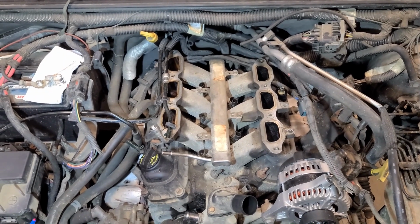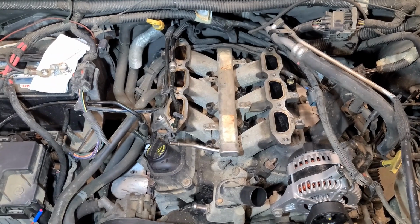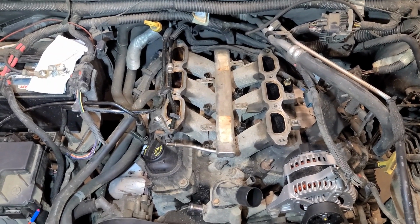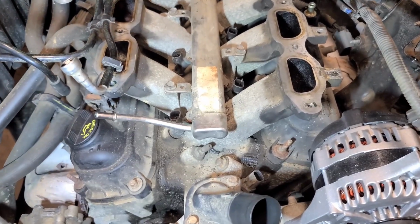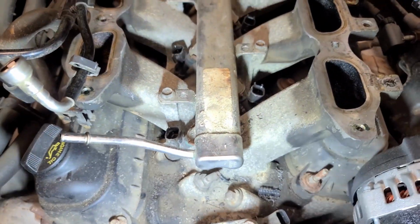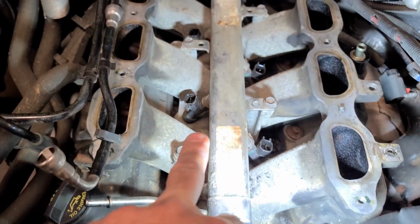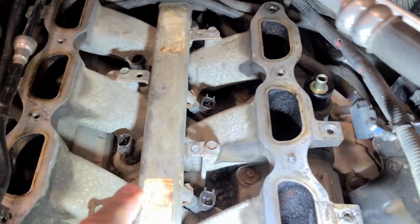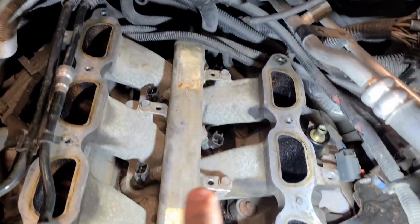Okay, flashlight's working now, and it's three times as bright as I remember it was. So we should be in good shape to take off the lower manifold here. There are 8 bolts, and they basically alternate side to side, here, here, and if you keep going back, you'll see that all along they alternate left, right, left, right, left, right.